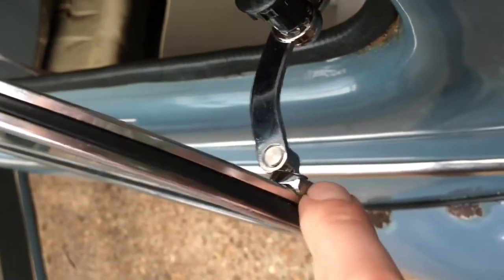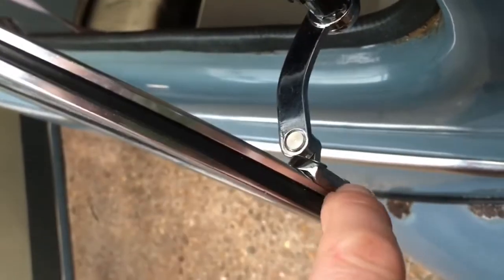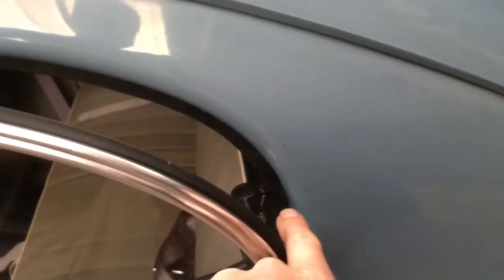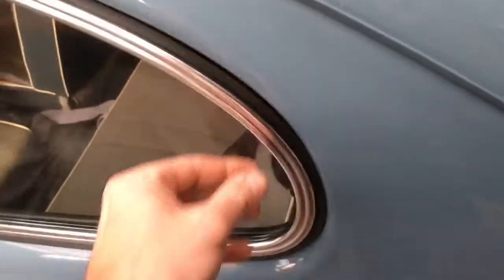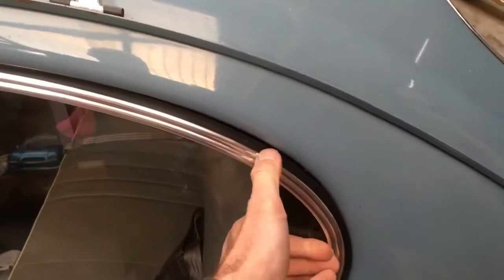The feedback is they look great but they don't fit perfectly, and I think the main reason is the thickness of the bracket. This piece here is mounted on the frame rather than on the glass, which is how it's done on later Beetles. So when you close it, this piece hits against the pinch welt trim or the metal edge of the window hole. That means the window will never sit completely flush — there's a gap mostly towards the bottom, which tapers inwards as it gets towards the end. I couldn't get it any better without VW having cut away part of that metal.